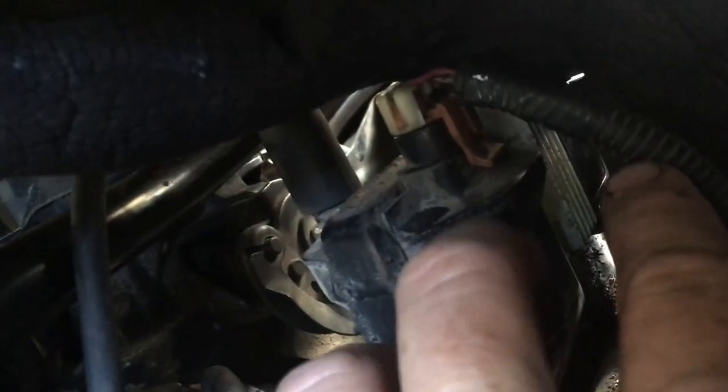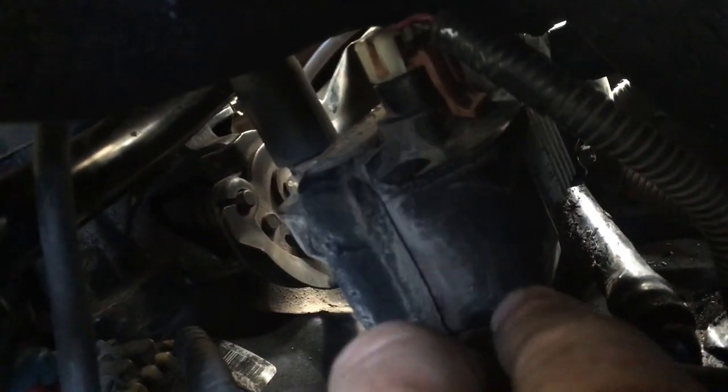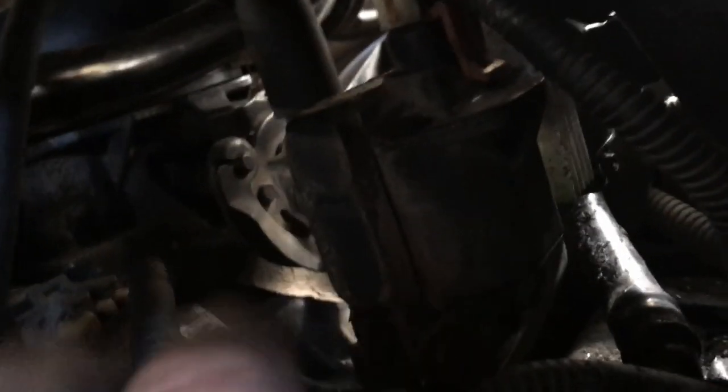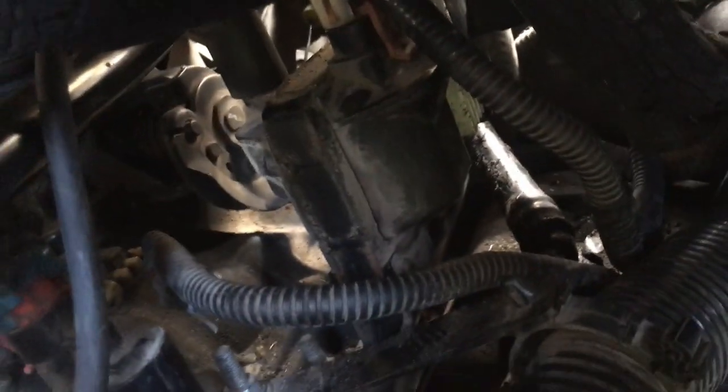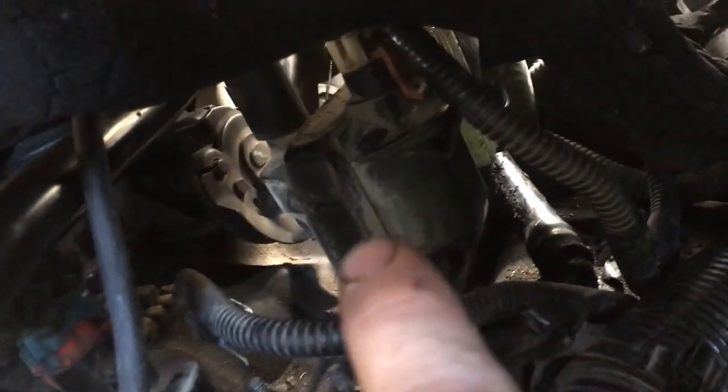I changed out the coil. I have a spare coil — I actually bought a new one just in case both my spare and the original were bad. I hooked up the new coil. It doesn't have to be fully grounded down — even if you're just holding a coil in your hand it would run. I've done that test a couple of times. I put a different coil on it, tested it, and it was still doing the same thing — not starting. So I knew it wasn't the coil.